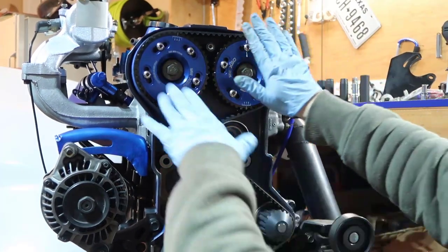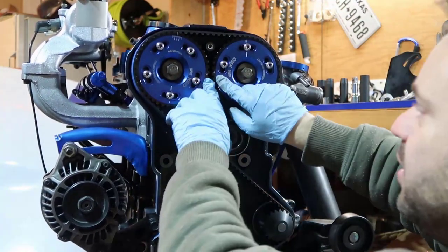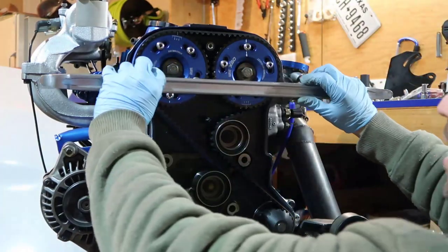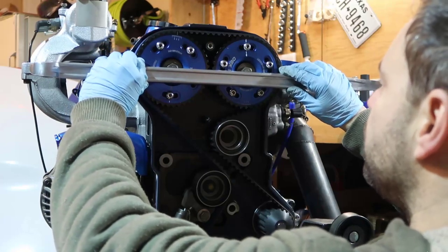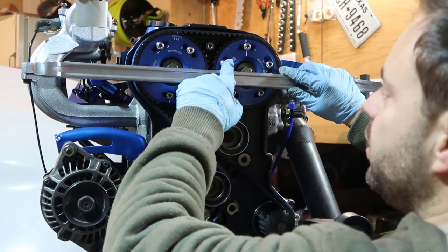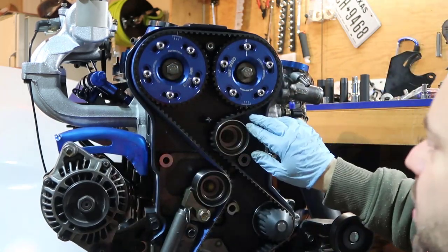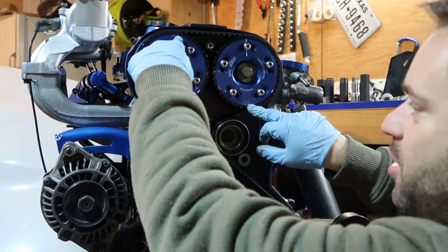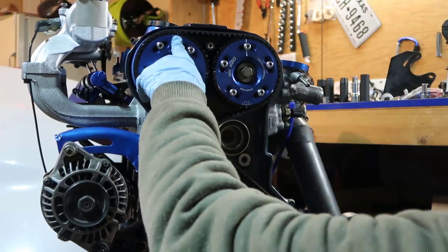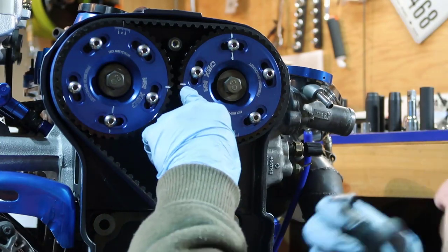So now we have the timing belt set, everything torqued and set to go, but the marks are not aligning. You trace a straight line between those two screws, right? And those marks should be right on top of this. So none of them are there. I need to move this a tiny bit up, this a tiny bit up, a little more, right? And even though this here is the factory marking, that's not the marking we are after. We can use this to know how many degrees we are moving. I extend that marking I made to the inside.